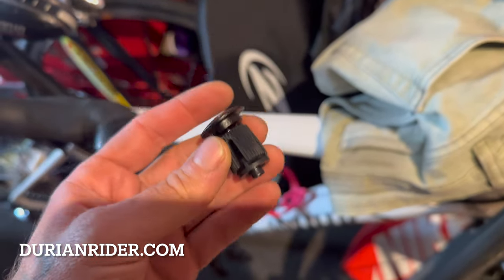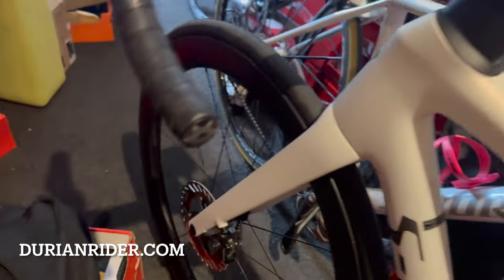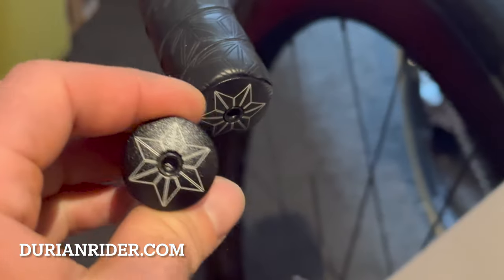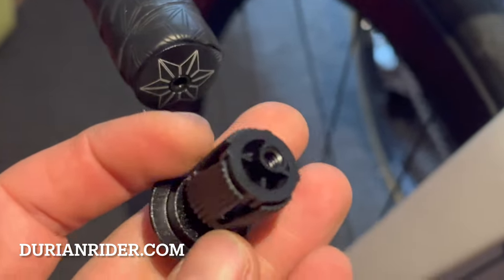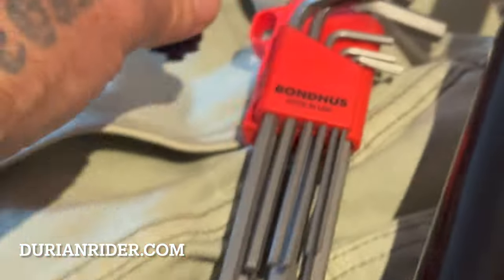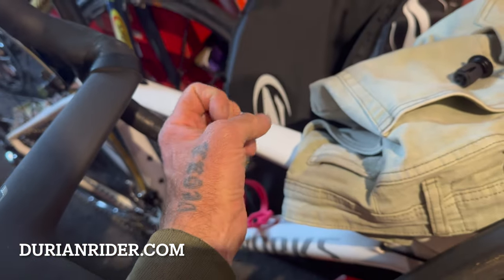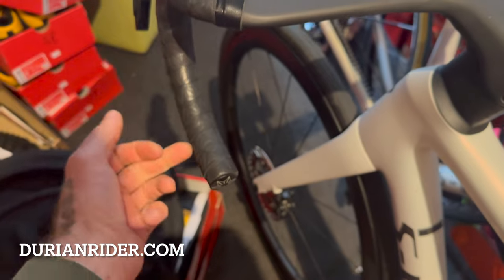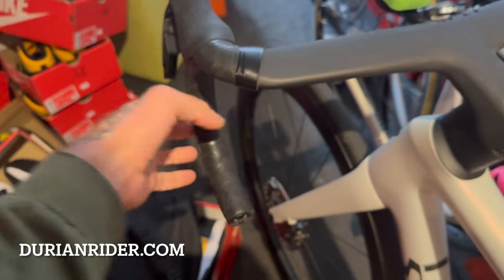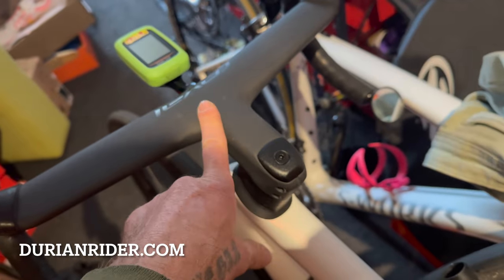This comes stock. Just put a KRBM 45 in there — very, very good race mirror. Not that this is a race bike, but we're trying to make it one. These things go in here, and when you do them up, make sure they're not too tight. Otherwise it's going to expand and crack your bars. It's going to cause spiral delamination up through here, and then you'll be holding the drops and all of a sudden your bars will just snap, and your dentist will be visiting you.